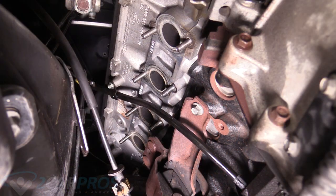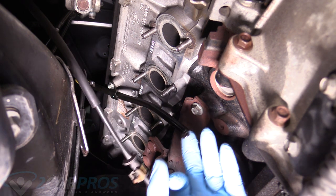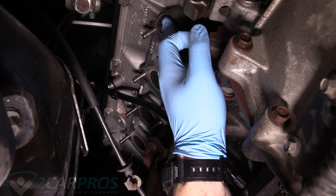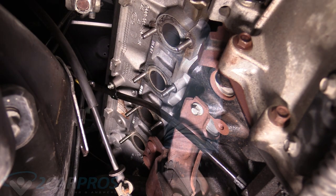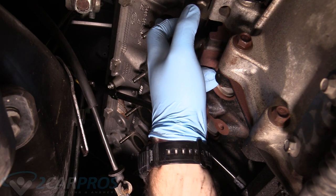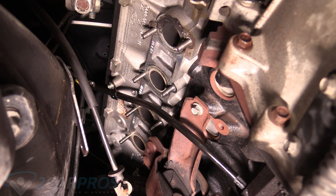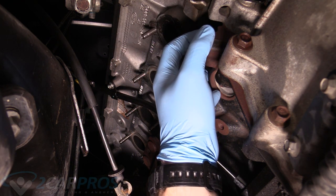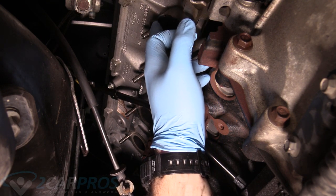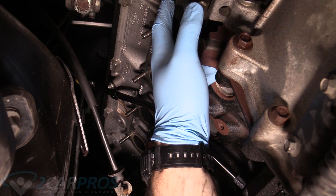And you're all good. So what we're gonna do is use some silicone rubber here, the really good stuff, because it's gonna get really hot. So you want high-end automotive exhaust quality silicone rubber. So we're gonna put a little dab of it on our middle finger here and go around the port here. Nice thin film. One more nut. This is gonna help our gasket seal those exhaust gases in. And before you start the vehicle, make sure you have waited the entire curing time on your silicone rubber, and that information is available on the tube.